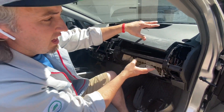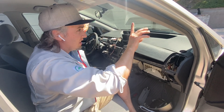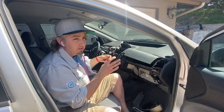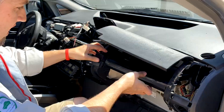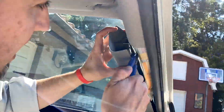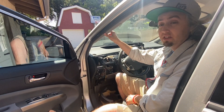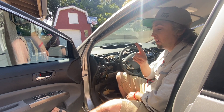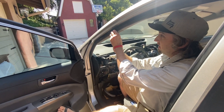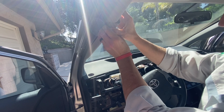You'll take those two screws out, the glove box will come out, and then we can remove the side trim here — you'll see that in the video in just a minute. Then we can pull the dash out — easy as that. With these A-pillar trim pieces they can be a little tricky, so I'm going to give you a tip on how to get these away and get them disconnected. Peel back the weather stripping and just pop it out like that.